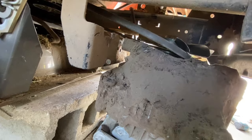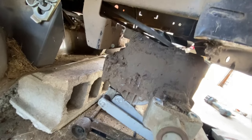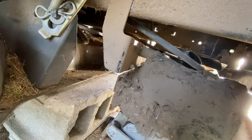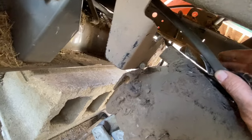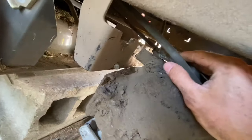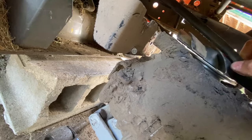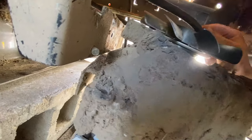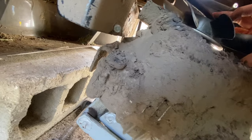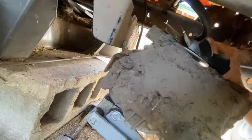I'm going to show you how I got this belt off — it's a little bit of a trick. Slide your jack forward as far as you can, and then pull this belt and slide it between the fan blades here. Then just rotate carefully, trying not to break the blades, and just rotate that pulley and the pump. Then your belt comes right off like that.